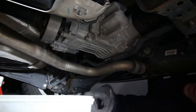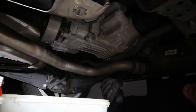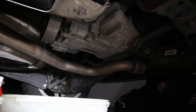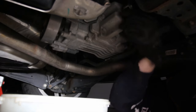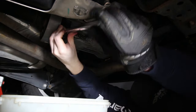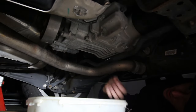You're not going to need a huge drain bucket under here — I literally just have an old butter container because the fluid that comes out is maybe going to be 800 to 900 mils. Nothing super crazy. You'll need an H5 or 5mm Allen wrench or socket for the top fill plug — that guy is loose, so we are good to go. Then fire in the drain plug, which should be an 8mm. The drain plug is now off.